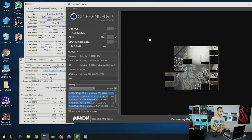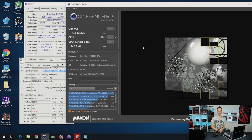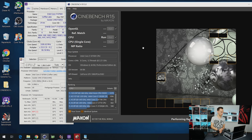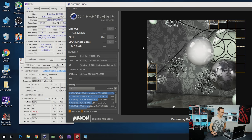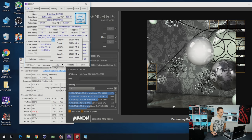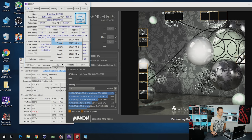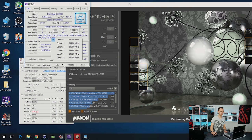Previously we had 850 points roughly, sometimes up to 900 points depending on what kind of load was applied previously, if the laptop was already hot or not. So let's see what the performance looks like now when we just run Novec. But I can already see if I check the clock in CPU-Z, it's already higher. So we have 3.3 gigahertz. So that's already looking promising. It's already a 300, 400 megahertz improvement just by adding some fluid on the laptop.